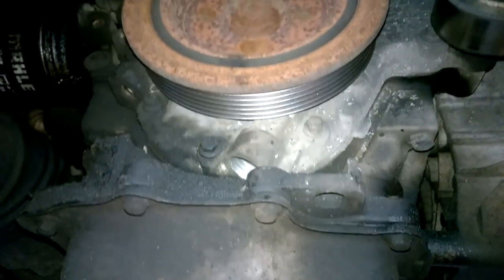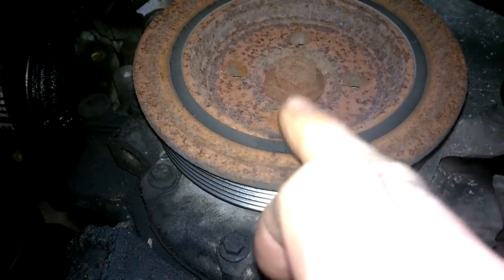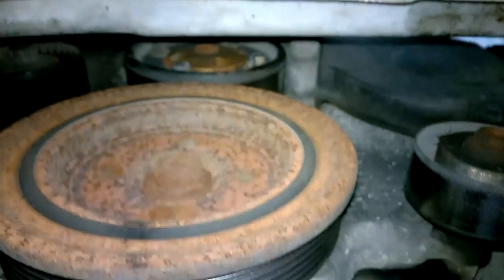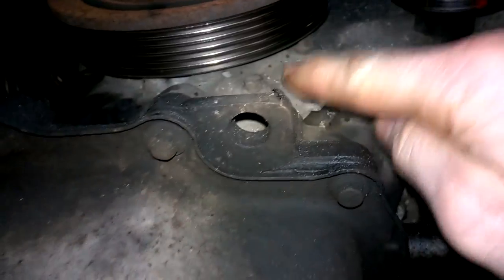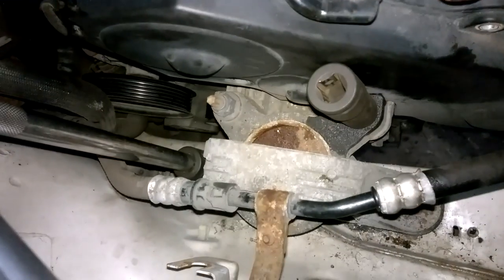We are now on the underside of the vehicle. As you can see, that's the crankshaft pulley bolt there. Once that's removed you're going to have to replace the seal — they always leak once they go. Once the crankshaft pulley comes off, we'll be removing this idler — there's a 10mm bolt there for the underside of the timing cover — and then you have your water pump, which also looks to be 10mm holding it on. After we remove all those items it will free up access to the wet belt, which is encased by this aluminium casing.